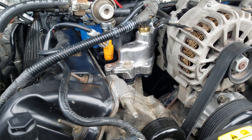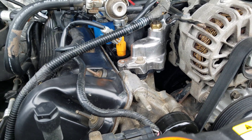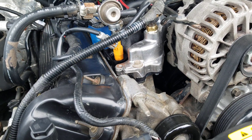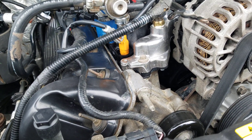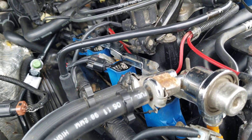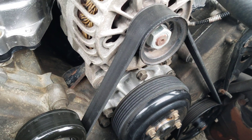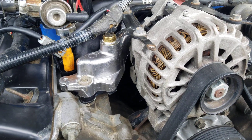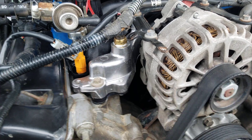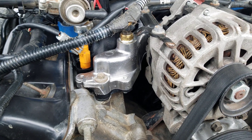The PI manifold is deeper. It has a couple of parts you have to put onto your car to make it work, which I haven't had any problems with yet. While I was in there — and I'd recommend this to anyone doing a manifold swap — I changed the ignition coils, plugs, water pump, and the little pulley. Just stuff that was coming off anyway to do the swap, so it was best to knock it out while you're in there. I also put a new temperature sensor in there.